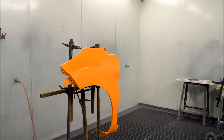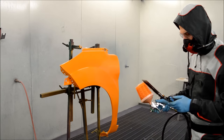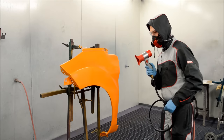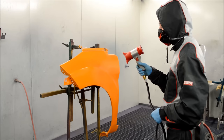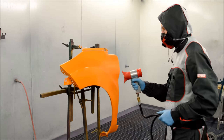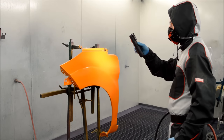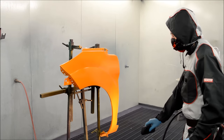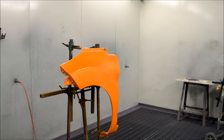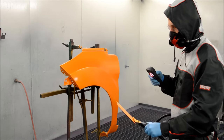You've probably noticed me moving the cup — you can rotate RPS cups in any direction, which is handy when spraying underneath a car. I'm following the same process on the test card throughout. We're going to dry the panel again — there's a lot of paint on here now, three ground coats and two pearl coats, so we need to make sure it's all fully dry to avoid defects. Once fully dry, we test it one last time with the Sun Match, checking for any patchiness or defects. That's it for the pearl application — we're jumping ahead to show the final finish.